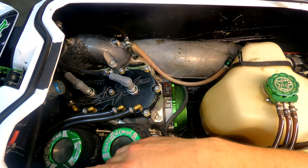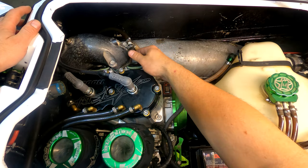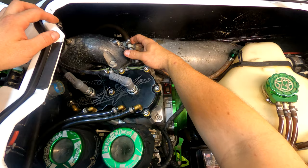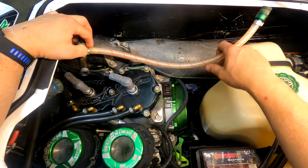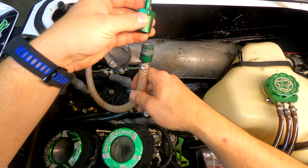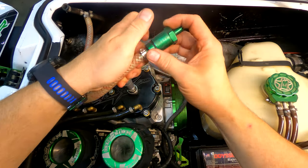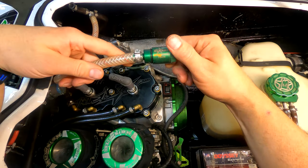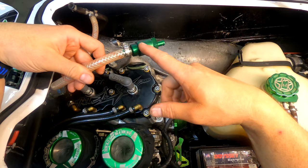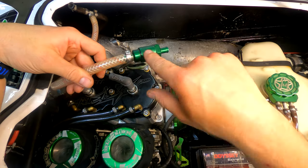This is an odd issue because there is flow coming out of those four hoses, and there's also some flow through the manifold line, and water is making its way out to the end of the pipe — the end of the pipe gets injected with water as well. Sometimes people install a spring and ball — plastic or metal — that restricts water flow on idle so you don't pump water into your water box prematurely; it only opens once throttle builds enough pressure.